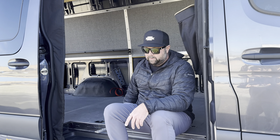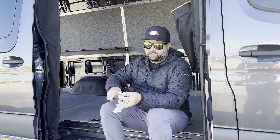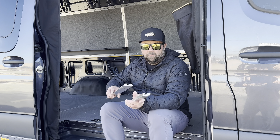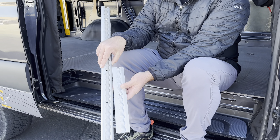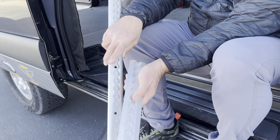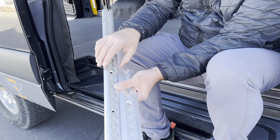Basically, it's an aluminum extruded tie-down tracking system. It comes in several shapes and sizes. We use the recessed flange style. There's also surface mount radius, surface mount angular, and square. Depending on who you buy it from, there are all sorts of different shapes and sizes. The real details are in this round hole pattern — a one-inch on-center machine pattern that's the same in all outer styles of L-Track.